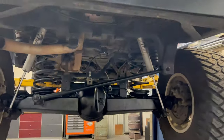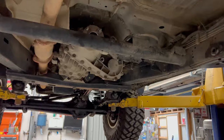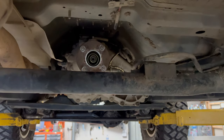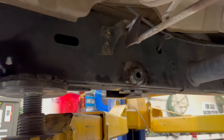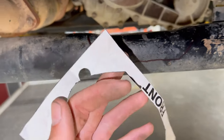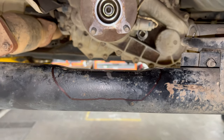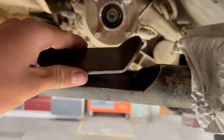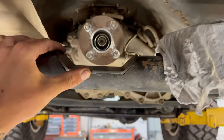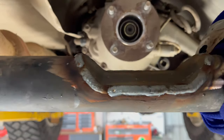Next day - got the car back up on the hoist and just finished pulling out the drive shaft. I'm going to do this notch - I'll mark it out, cut it out with the grinder, then prep it up ready to weld so I can paint that and this side all at once. This is the template here - I've marked it out, those holes there and there just line up with that hole there and there. Now I'll cut it out with the grinder. Just finished doing the notch - that'll sit in just like that, so I'll prep up the surfaces getting ready to weld.